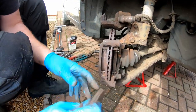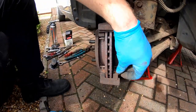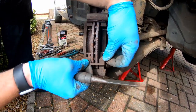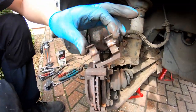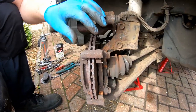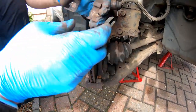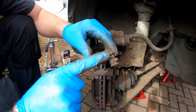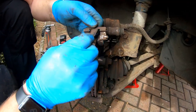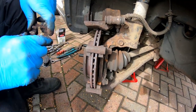They've definitely seen better days. These little spring plates pop off and as you can see they're quite heavily contaminated with brake dust. We'll be giving that a good clean, and the same little one at the top, because that's where the pads mount and they need to be able to move quite freely. If it's all dirty, corroded and horrible they're not going to be as effective as they should be. I'll get some wipes, give them a good clean and then we'll come back in a second.